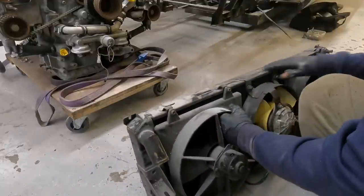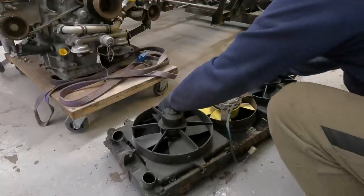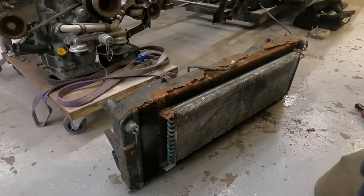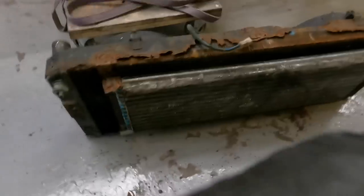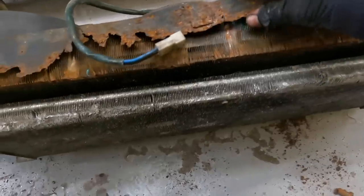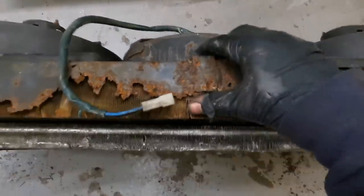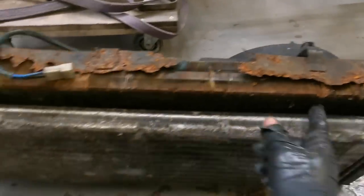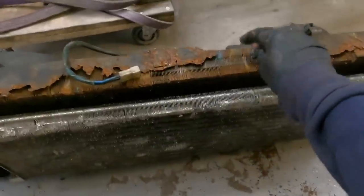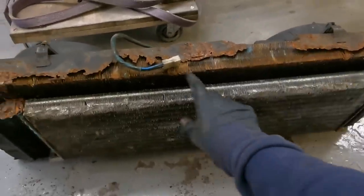One of the parts that actually suffered the most on the BBI was the radiator. With its location tucked at the front of the car sitting on the chassis frame, the car's design actually allows water to sit in the bracket holding the radiator in place, slowly rotting it away over the years. I strongly suspect that many Boxers, not just mine, actually suffer with rust from that design flaw, because there's literally no way of seeing that area without completely removing the radiator. So somehow we need to sort this mess out — it was time to strip it all apart and send it off to Frank, my radiator guy.